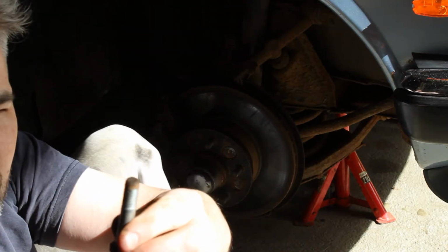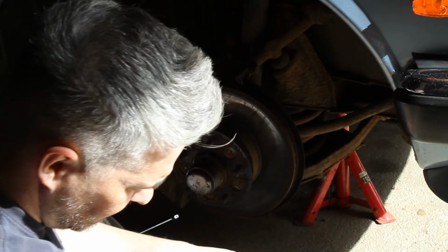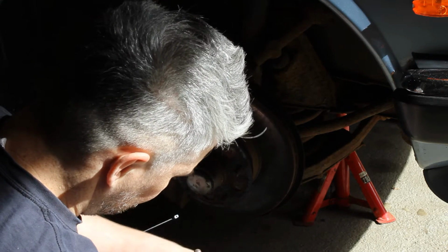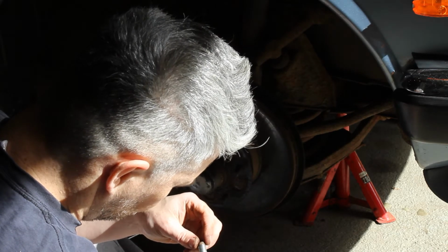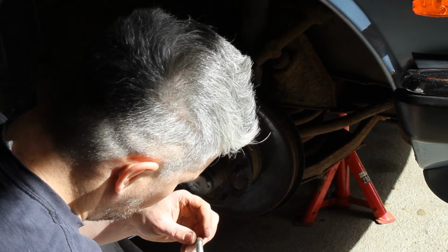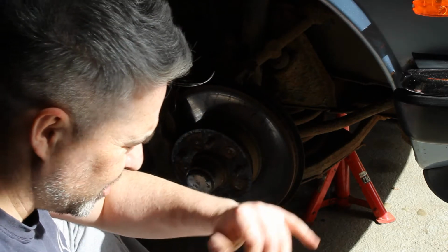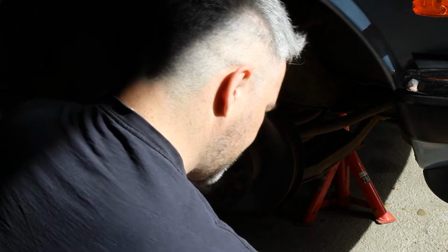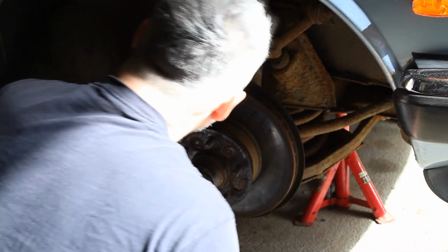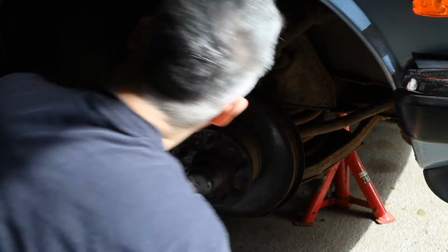And here we go. So this has been out, somebody's greased it. In fact, I would have said, if I didn't know better, that bolt was fairly new. It's certainly good enough to go back in, or just chase the thread with a die, and we'll be good to go. That's good as well. Right, so now we have to do the top.